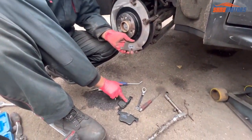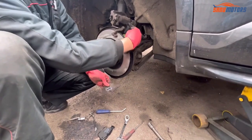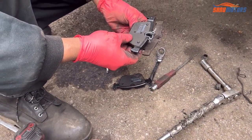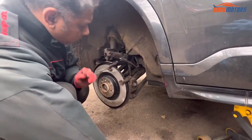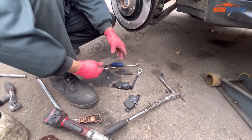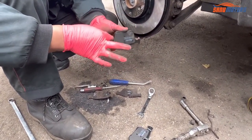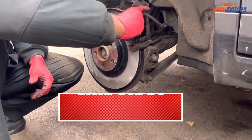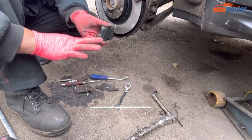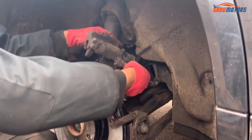You can see there are two types of brake pads — one brake pad has an internal groove, and that one needs to go inside. The other one needs to go outside. I'm going to check the old pad and the new pad are identically the same. The other pad is stuck here. Right — the outer pad also checks out identically. Then I'm going to apply a slight amount of copper grease here and install it. Then the other side — same thing, apply a little bit of copper grease and install.